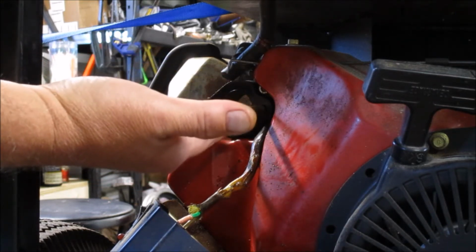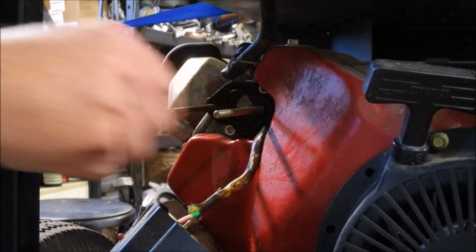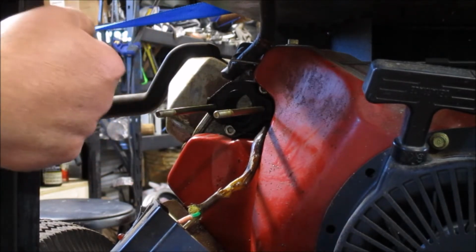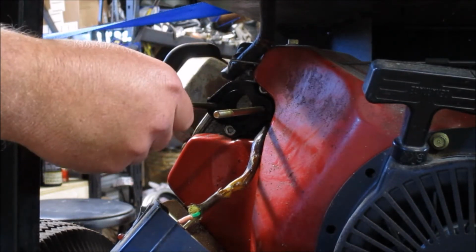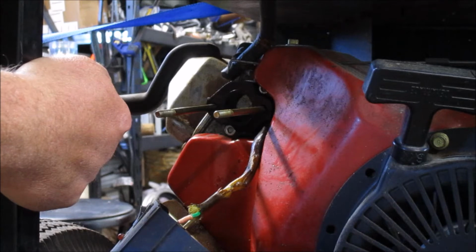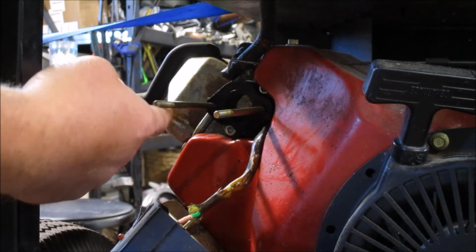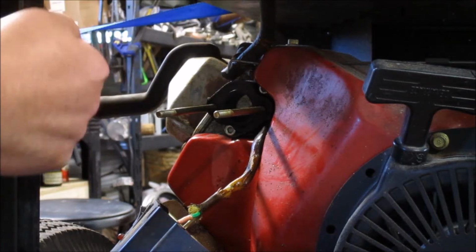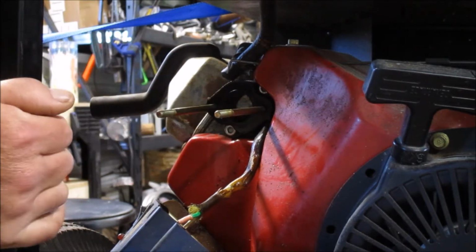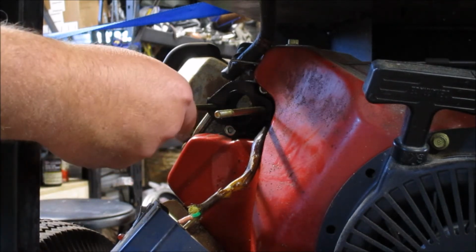to hit these. You can leave them exactly as they are, because normally they are screwed directly into the block, and you could wind up damaging the area where it's been bored to accommodate these. That would just be a can of worms. You'd have to tap it, find some larger studs to go in it, and then the carburetor would have to be opened up to accommodate these larger studs, but it does not appear to be the case.